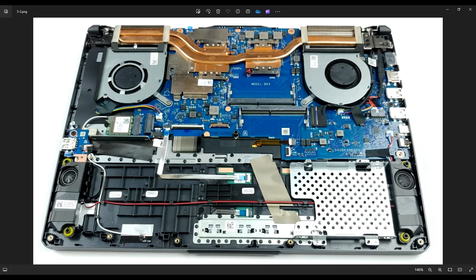After that, you have your heat sink here — it goes from this vent and this vent over your CPU and GPU. Check out this warranty or caution sticker over that screw. You may see these from time to time in various parts of computers. When they see you've messed with that sticker, they know which section of your warranty to void. So keep that in mind for any computer repair — watch out for those, and if you don't want to void your warranty, you may not want to do any DIY past that point.